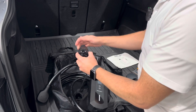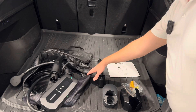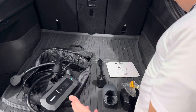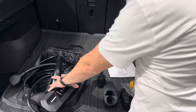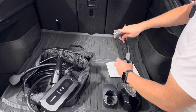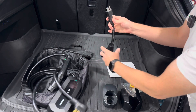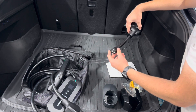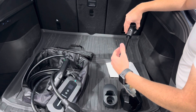This is level two charging, meant for overnight charging your car. It comes with a nice carrying bag so you can store this in your car. If you're going on a road trip, you can take this with you — whether you're staying with friends, family, or at an Airbnb, you can plug in. The cool thing is this also includes the 15 amp cord. You simply plug into this and plug into a regular 110-volt 15-amp wall outlet. This will trickle charge the car — it's not going to charge fast, but it'll give you some power.